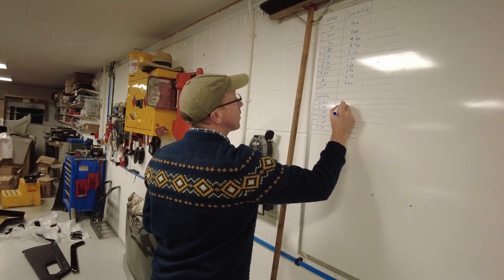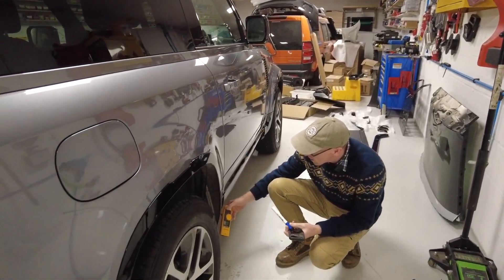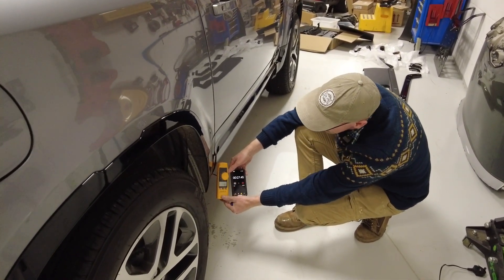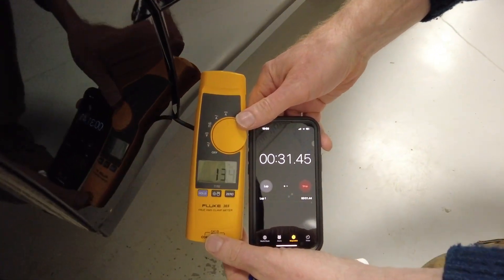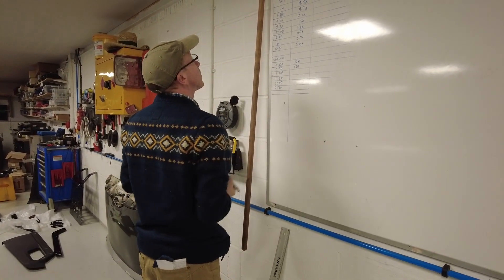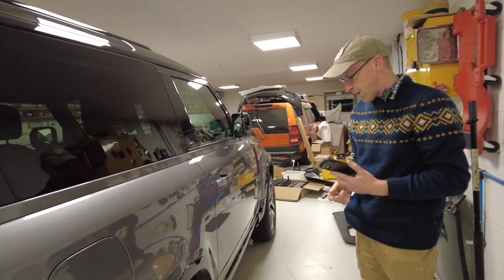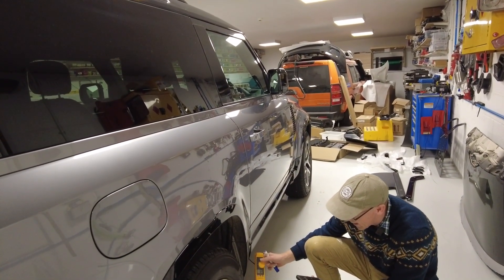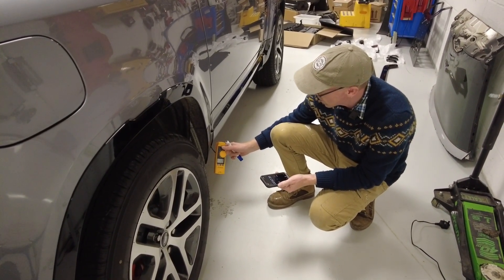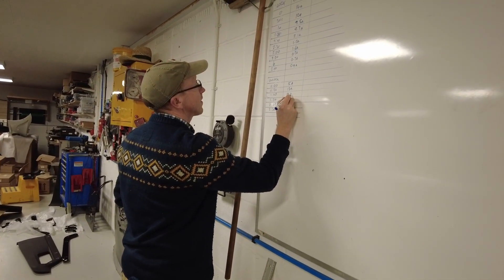So we've got unlock. What we'll do in a minute is open the door — let's see how long just by unlocking it. 13 amps is falling, so 13 amps at 30 seconds. It's relocked itself. So if you don't open it, it relocks itself, but it's still taking 11 amps locked, which will just follow the other curve. A minute is like 9.7 amps.